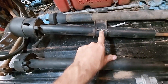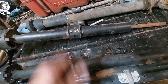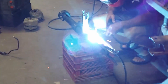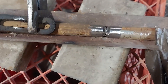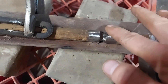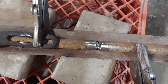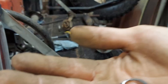Here are the two pieces in question on the truck column. I didn't drill out the spot welds — I managed to carefully grind them off and got them thin enough to just knock the bracket off, and I miraculously managed to do it without gouging into the tube. Getting it off the Bronco column, I just drilled it out, got everything marked and measured, and I'm going to go ahead and weld these two together. Before I welded that, I went ahead and cut the end off here just so I could get it in my chop saw without having this bracket in the way. My measurements are telling me I need to add eight and one-eighth inches of tubing, which I'm going to take off of this one. I beveled the heck out of that — I'm going to need good penetration because I'm going to have to grind the weld back down to this diameter to get the shaft to slip up through the bushing in the bottom of the column.